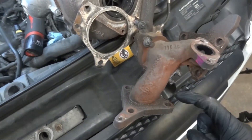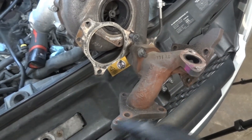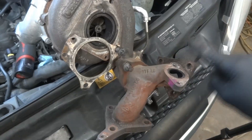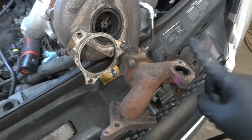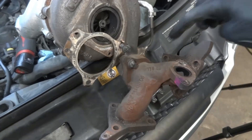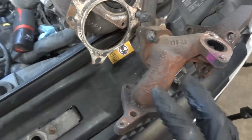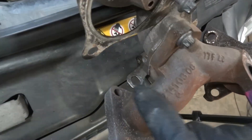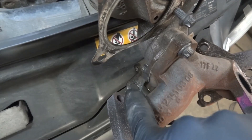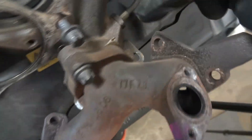The next thing was removing these bolts that connect this manifold to the exhaust manifolds on each cylinder head — this goes to the driver side, this goes to the passenger side, and the EGR tube goes over here. I put a mark here to know which way the gasket is going to go. There's one bolt here — three bolts on this side and three more on that side. After that, you have to undo this bolt which holds the turbo on the block — there's one here and another one here. I undid these two bolts.